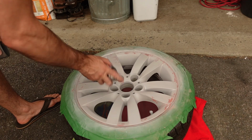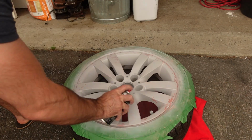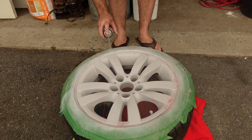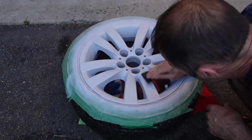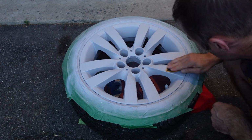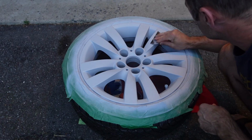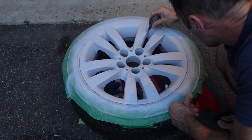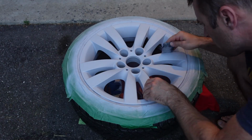And after I get an additional coat of primer on to cover up that glazing putty, I do take, like I mentioned, 800 grit sandpaper and do a light sand on the primer once it's completely dried up. Obviously, if it was still tacky, it would definitely ruin your primer job and you'd have to start over. It would look like garbage. So wait till the primer's dry, then you could use the 800 grit sandpaper on it.